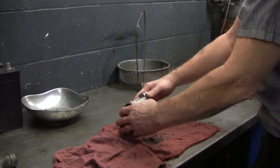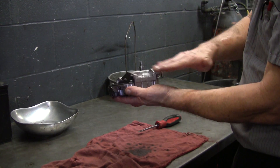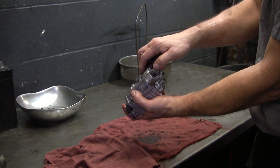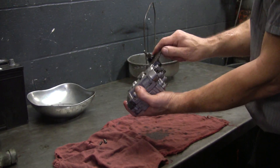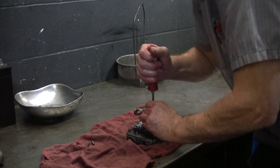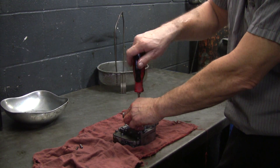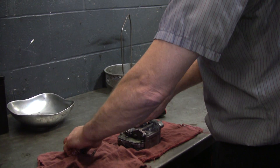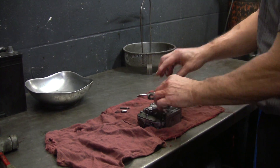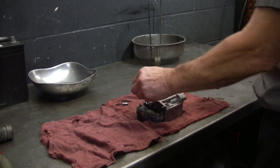Obviously the silicone is kind of alarming. Sorry, I don't have all the valve body combinations memorized. This thing splits in the middle — we've got a valve assembly over here, another valve assembly here, and then another one here. This one has a detent spring-loaded piston that holds the gear selector in position. Why would you put silicone on it? You don't. Some people want to seal everything, but anybody in the business who knows anything about transmissions knows you don't put silicone in there. Somebody thought there was a leak and had a better idea, I guess.